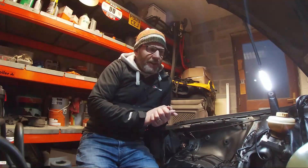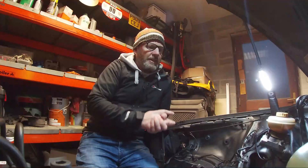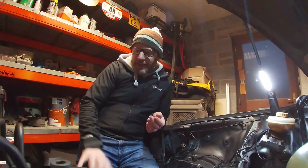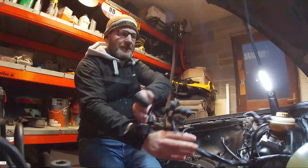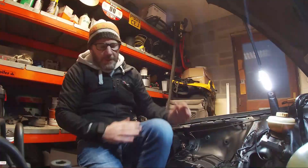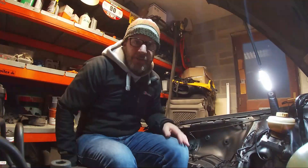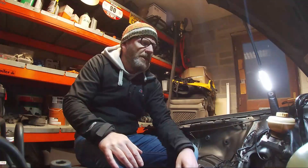We've been getting things in place and clearing out a lot of the wiring loom in here which isn't needed — the big load that's for fuel injection, cooling for the rad, and all that. There's a massive load of loom which is not needed, but there are a couple of sensors in there which feed back to the instrument cluster. I should be able to reuse those for signalling, temperature control, and potentially reuse the fuel sender to show state of charge.